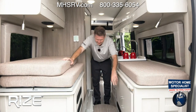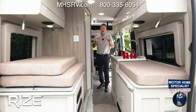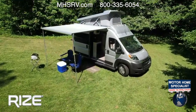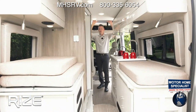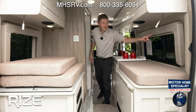Let's talk about climate. Because this has the sky bunk, you lose the roof AC. With the sky bunk option you get a cabinet air conditioning unit — that's 5,300 BTUs. The standard on-air roof air conditioner without the sky bunk is 11,000 BTUs. If you have the rooftop unit, it's controlled through Rapid Camp Plus. If you have the cabinet unit, it's controlled right back here.